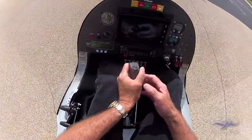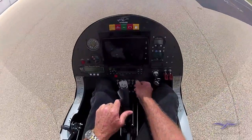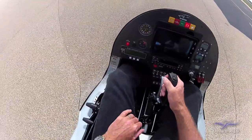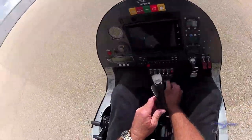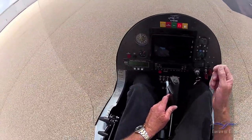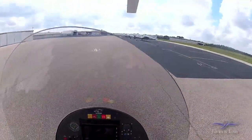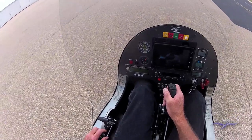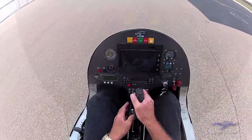Let's see if I can do this without killing myself. Park brake is set, master switch is on, I've got the lights. Trim is full forward, safety belts, helmet's secure. Cyclic is free but I still got the lock on. Altimeter's still okay, breakers are all in, radios are off. I'll leave choke — I don't need one boost pump for start. Mags to both, throttle's cracked, cyclic forward. Clear prop.